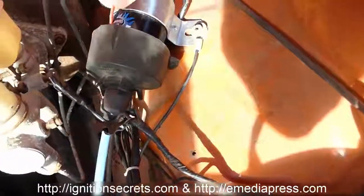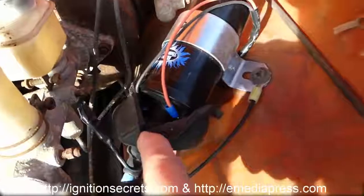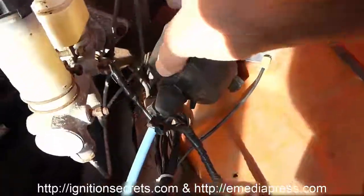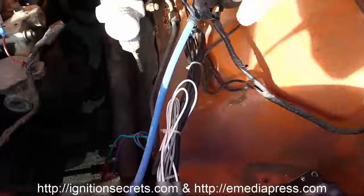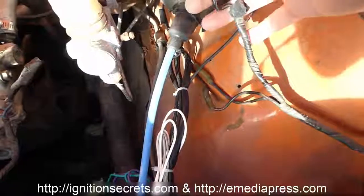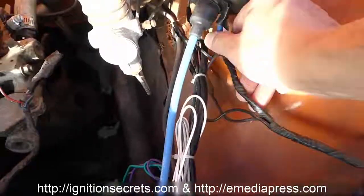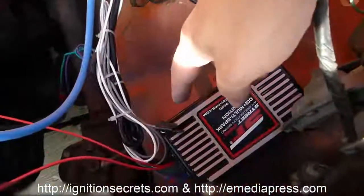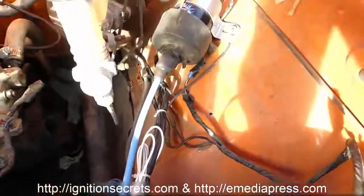And then the other wires are, there is an orange and black one. I believe the orange one goes to positive on the ignition coil, and the black one goes to negative. And so it's really simple, and that's all there is to the entire installation. The wires that were on the ignition coil, you don't want to add them in parallel. You want to remove the originals, tape them up or something, and mount those somewhere, because you're not going to need those, because this supplies the capacitor is what's discharging to the primary of these coils.